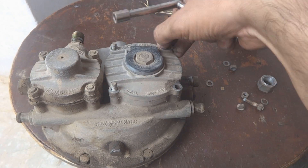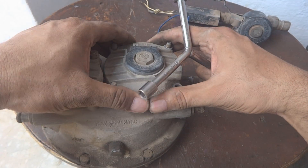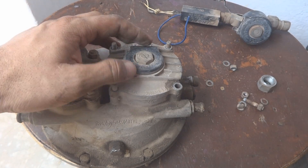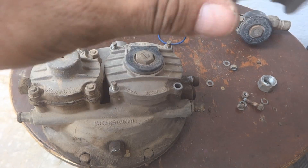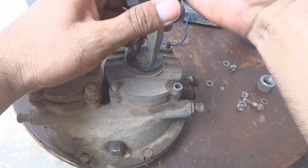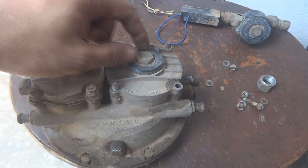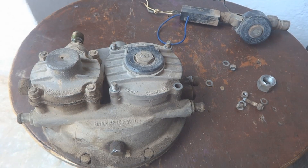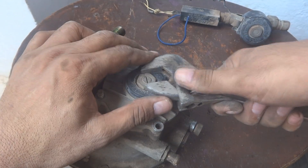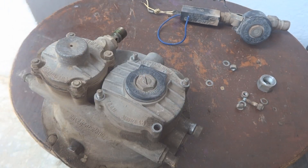This nut just came off, and this piece will come off too, but first you will have to remove the solenoid — without that it will not come off. So we will be using pliers or a 19 millimeter socket to remove it. This is very hard — 19 millimeters — so we will use a 19 millimeter socket to bring this nut off.